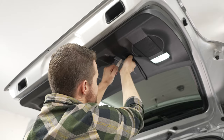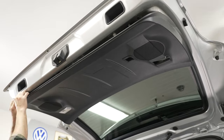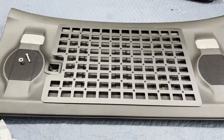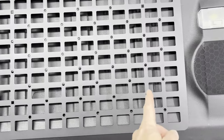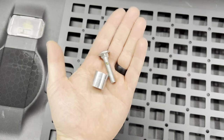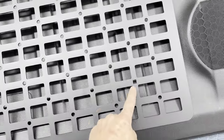To install the rear hatch MOLLE panel, you'll need to remove the plastic panel from the truck. Remove the handle cover with a pry tool, then the 10 millimeter bolt that holds the handle in. Use a bone tool and pop the corner of the panel loose, then carefully pop out the rest of the clips. Before removal, disconnect the two cargo light wiring harnesses. We got the panel here on the ground, and I've centered the new MOLLE panel. Line it up with these three ridges. We'll have four carriage bolts and spacers that we need to drill holes for — one there, there, there, and there.